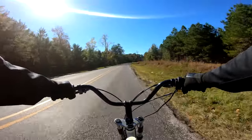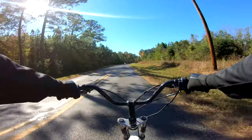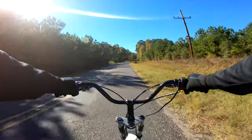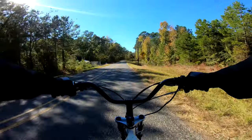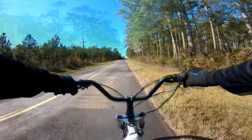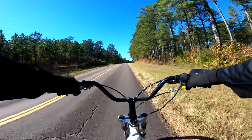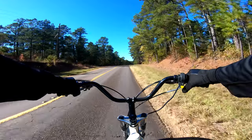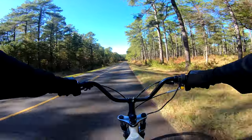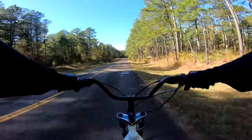User experience and reliability. Well, for reliability, I've only owned it for a few months and put a few hundred miles on it, including the test ride you've seen today. It showed promising results, so for now, I'm going to say reliability is good. As far as the user experience, these motors seem to be a lot less finicky and picky as compared to something like the Minarelli hybrids, which require a near-perfect tune from day one, otherwise they just give you grief. In the short amount of time I was choosing the jets to get the tune as good as I could, it didn't give me any grief when the tune was poor. No soft seizures or any issues like that. So, in short, if you're a rookie builder trying to get into these performance builds, the chainsaw hybrids will probably give you an easier time than the Minarellis.